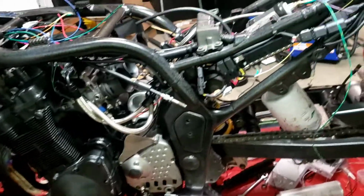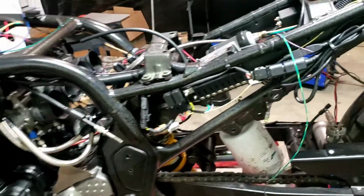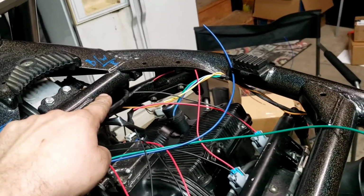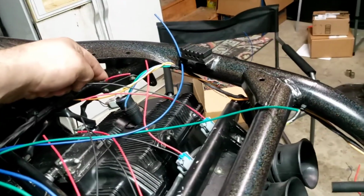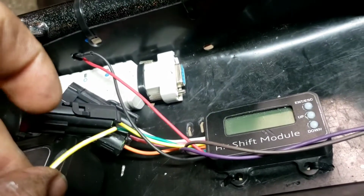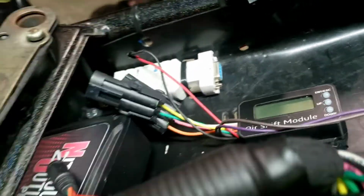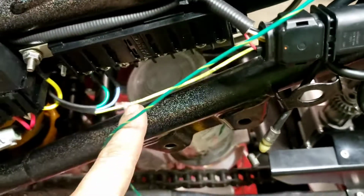Pipe dope. Other than that, yeah, we got this yellow wire for the coil power, which is going to go right here, is running back here so that it can go into the RSR on the, you guessed it, yellow wire. We'll have green wire coming out of there following this same wire, except it'll make a hard turn and go into the fuse box. That way we have spark cut. So that'll be the bulk of our RSR wiring.